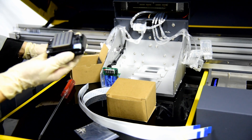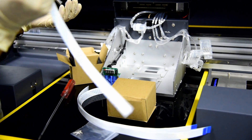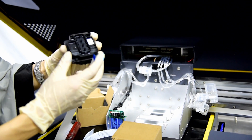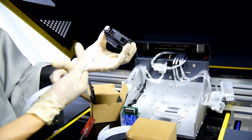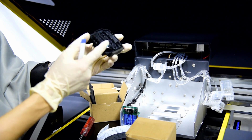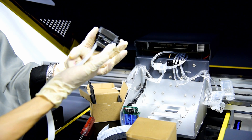We take our print head and make sure it's clean and undamaged. This is the print head cable. When we look at the print head, we install by this side, with the decoder at the front side. At the print head, the left side and the right side have two ports to connect the print head cable.